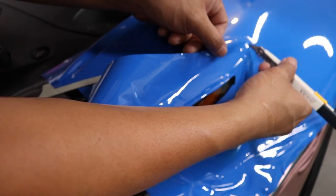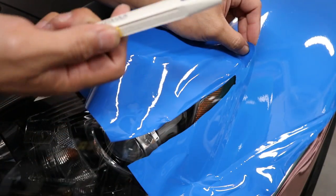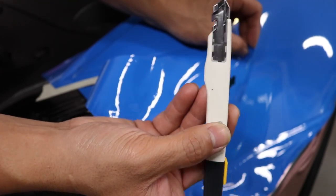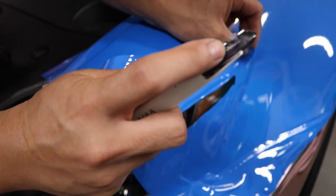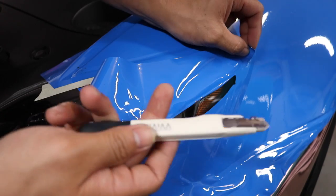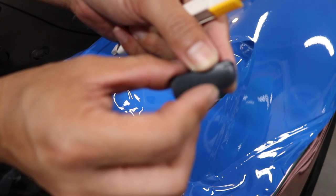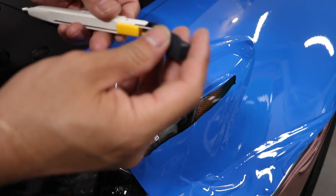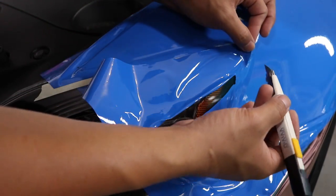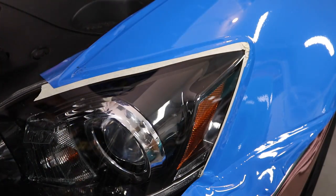Just going to lightly run this with no effort at all. I'm using Vivid's new cutter right here — it's really nice, made out of plastic with a metal interior. It has a little piece to cut knifeless tape and things like that. It uses 30-degree blades, which are really nice and simple. The back part comes right off so you can cut a piece of the blade off if you need a fresh one — really convenient. You can get that on their website in the link below. I cut that off and the vinyl is on the masking tape, so it's going to be super easy to actually tuck the vinyl in.